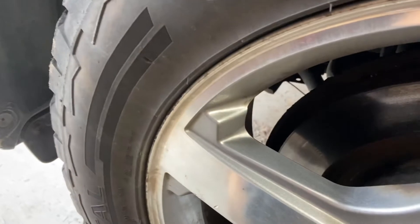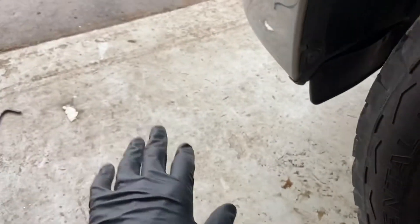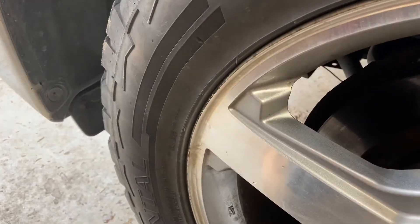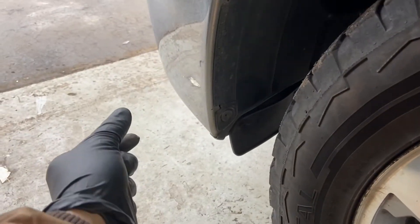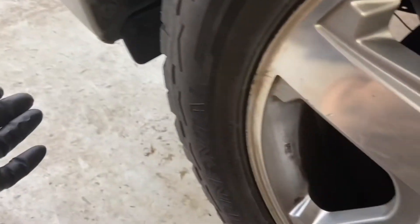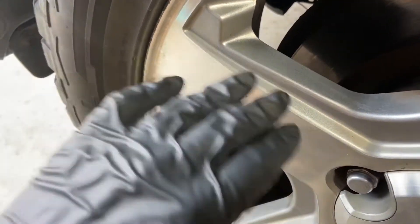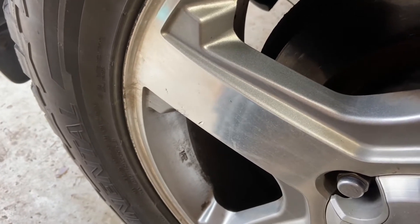So I'm driving down the road, listening to the normal sounds you would hear from a wheel bearing, and I flipped to the one connected to the differential and it was like — wah — absolutely amazing how easy it was to figure out what my problem was. And just recently I was on a 2002 Camry with a loose clanking sound over bumps. When I got to the one for the sway bar link — which I thought wasn't the problem — it was super obvious that that's what it was. So I had a $9 fix.